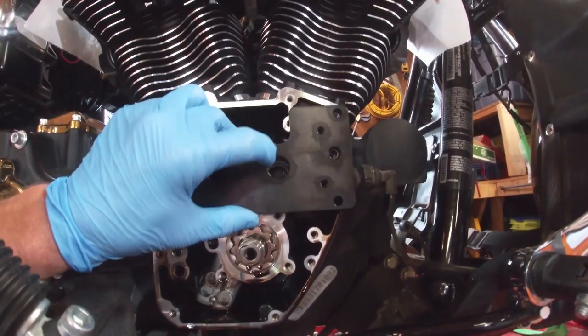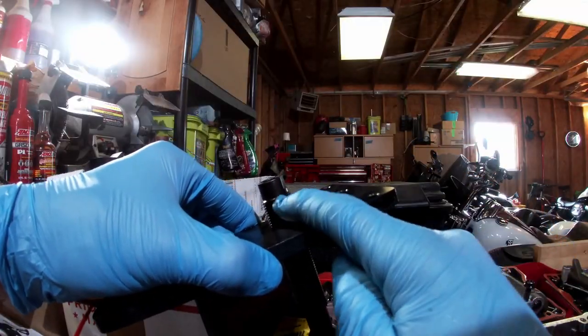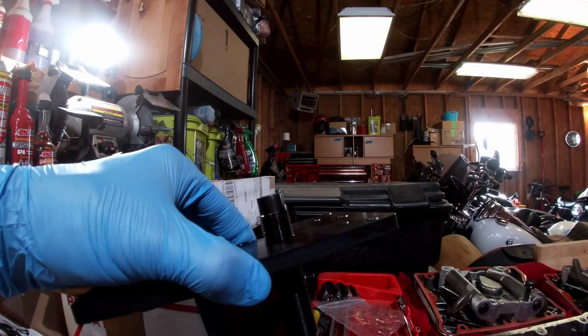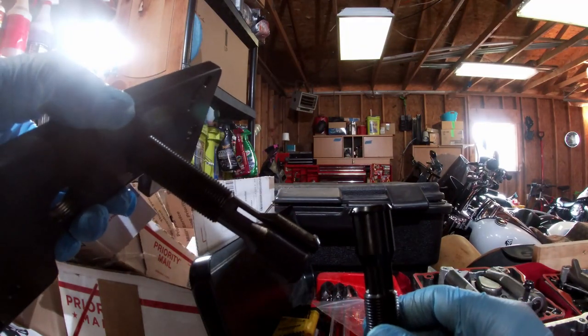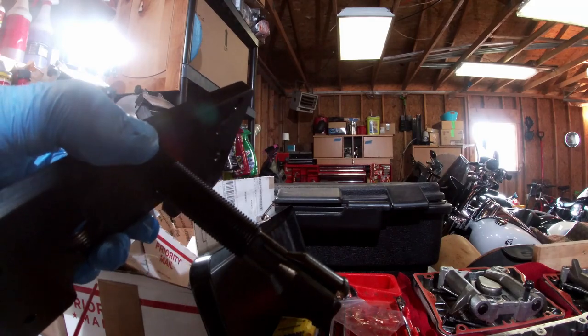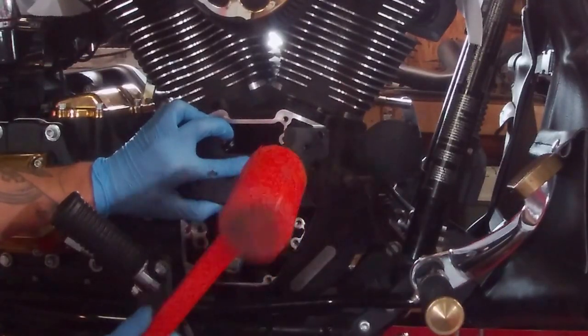The first step is to screw the collet into one of the two holes. I lubricated the threads and then screwed the collet in until about an inch and a quarter is left sticking out. This is the larger of the two collets because that's the size of the bearing in a 2017 Dyna. I held it up to the bearing and gave it a whack with the hammer to get the collet to compress and fully insert into the bearing.